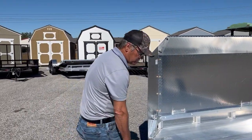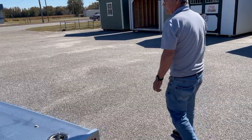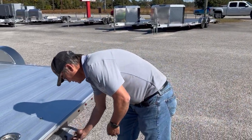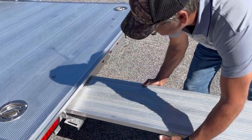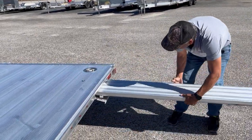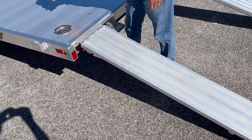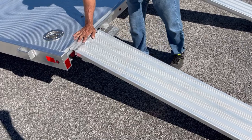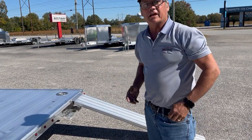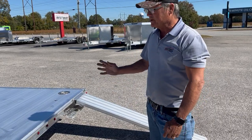What's really special about this trailer is it's made for loading low-slung cars. The problem with a ramp trailer — when you have a car real low to the ground, it doesn't have to be that low — there's going to be a problem. The problem is the incline: when the tires come up, the undercarriage of the car hits the trailer. You have somewhat of the same problem with an all-out tilt trailer, where the angle of the trailer is down and the air dam, the real low-to-the-ground air dam, hits the trailer before the tires start to load. The approach angle is the problem.